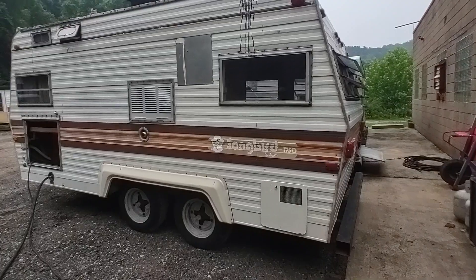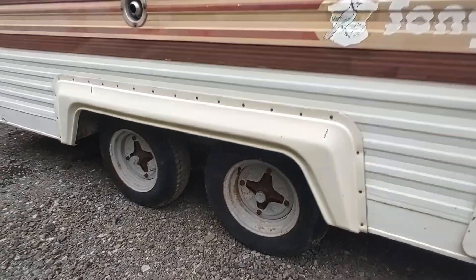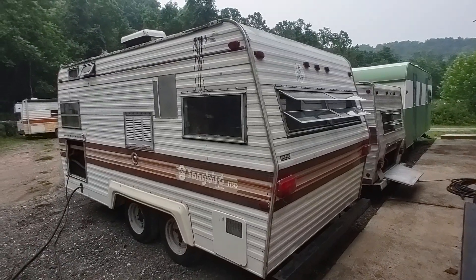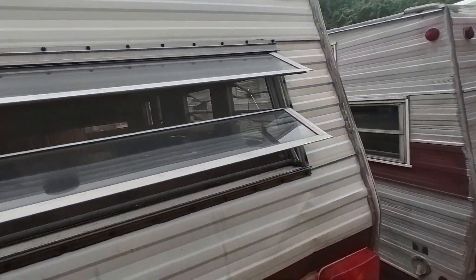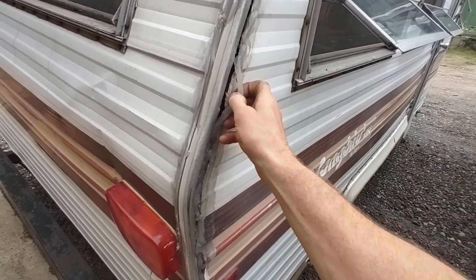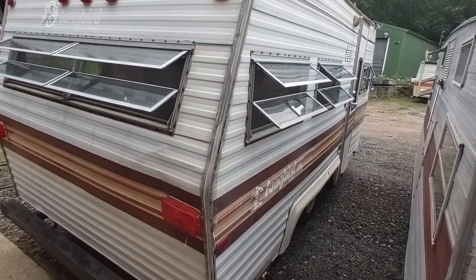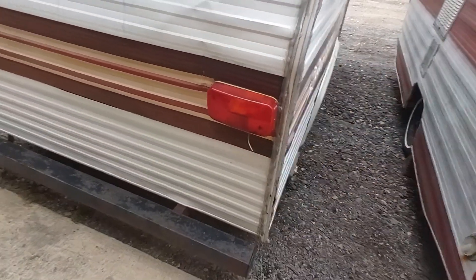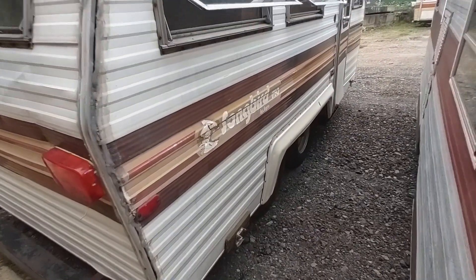This one does need some work. It's got four pretty decent tires on it — I didn't notice any cracking. They're not brand new but they're not toast, and the sheet metal is in pretty nice shape. All the windows seem to work. This corner here in the back is split and coming undone — somebody tried in vain with silicone. The wood in there needs done. It does have a dent right here. The tail lights were working but the marker lights were not; I'm sure that's a ground issue. The brakes were working, so that's good.